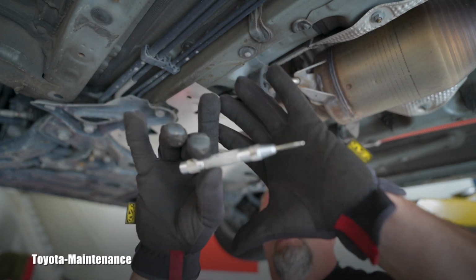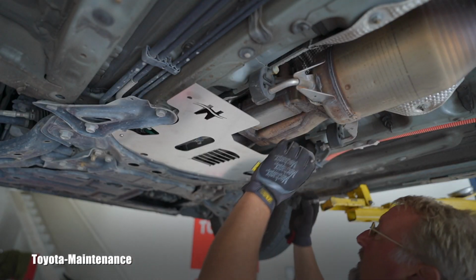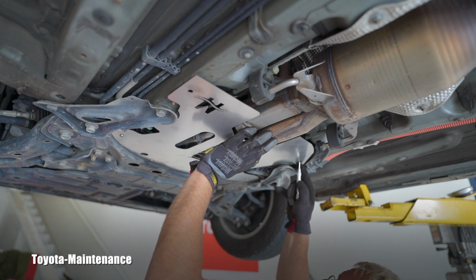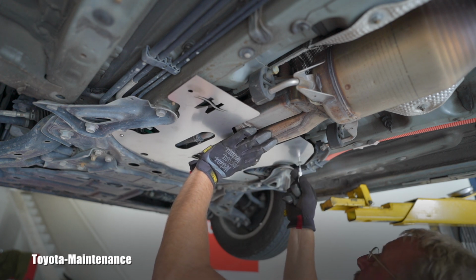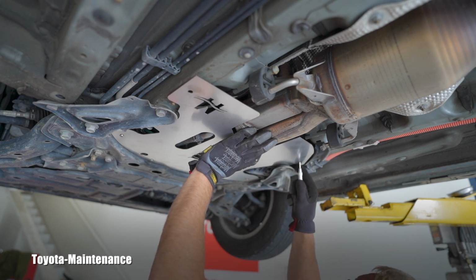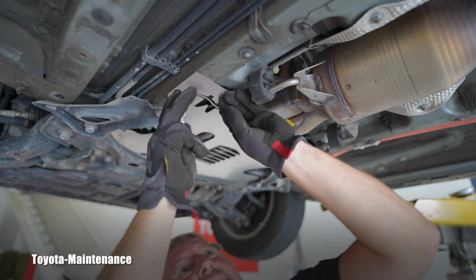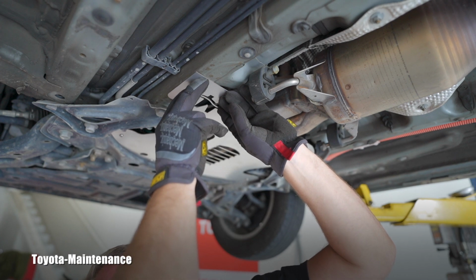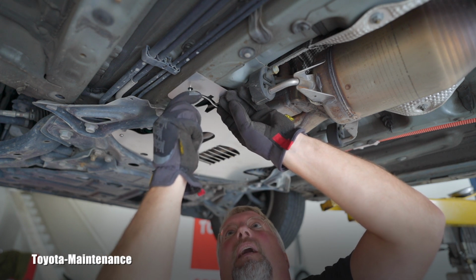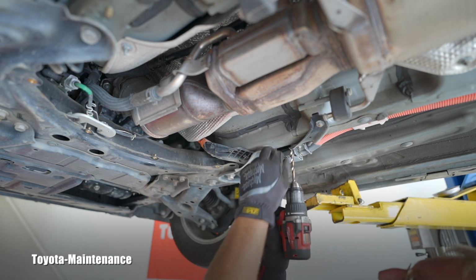And I like to use this tool because it's a spring-loaded punch. So having it perfectly positioned, I put it right in the center of this hole, and look what you do. Right, I said there is that spring, and I have perfectly marked the center here. I will do the same on this side, right in the middle. Yep, that's good. And I can remove the shield. I perfectly see that mark right there.